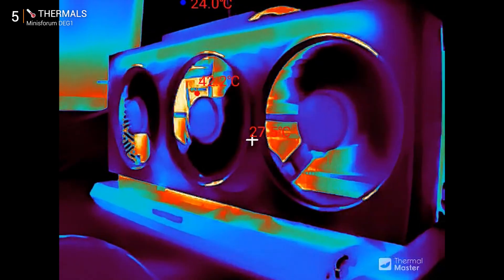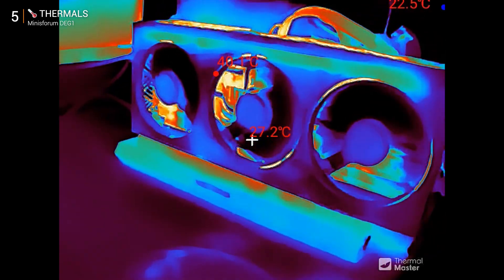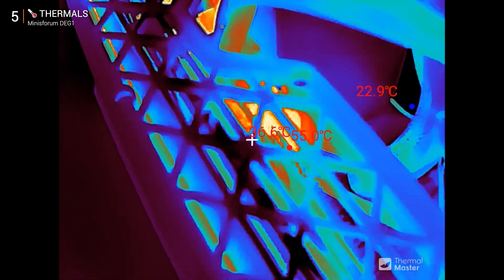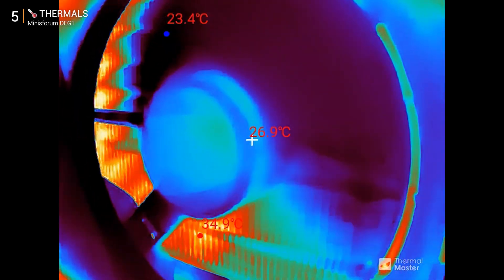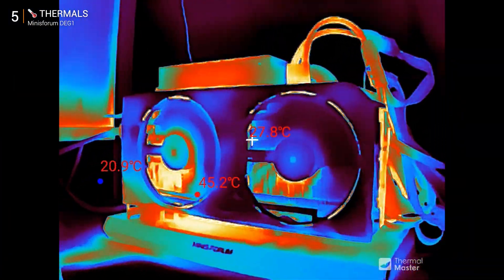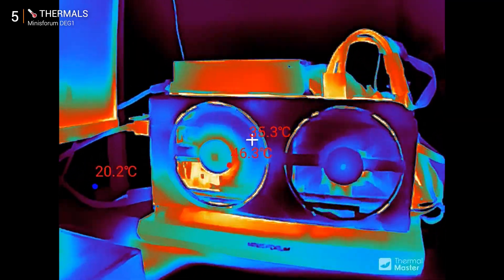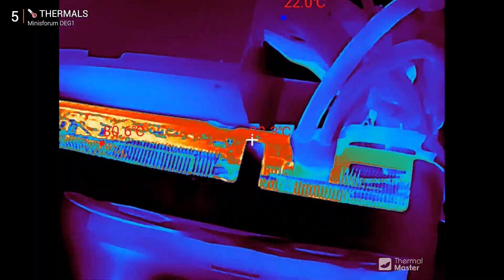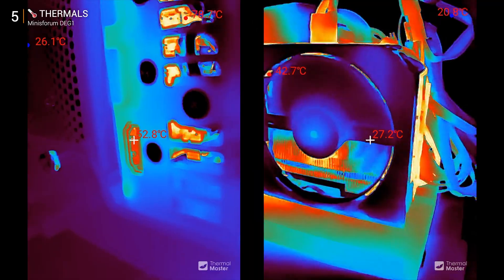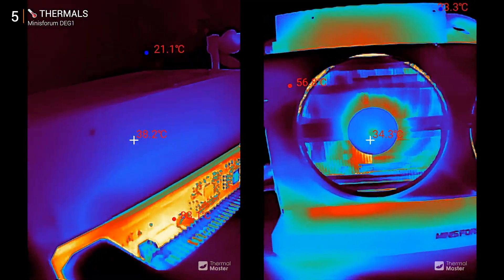After pushing those frame rates, the next question is always: what about heat and noise? The open-air design of the DG1 shows its strength here — with no enclosure to trap heat, cooling feels almost effortless. On my thermal cam, the Radeon triple-fan card often didn't even spin its fans during lighter loads, and the smaller dual-fan RTX 5070 showed the same story: temps just as good as the triple-fan. Three fans are overkill here; two fans are plenty. Airflow is never a bottleneck, noise is minimal.